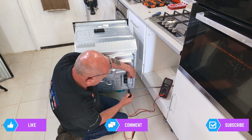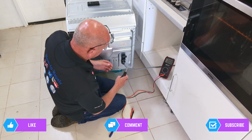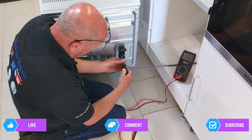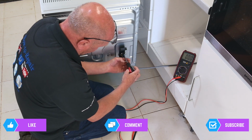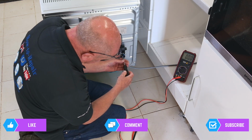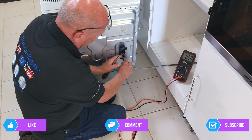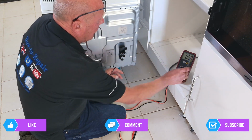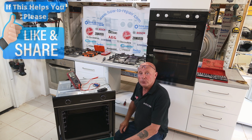Undoing the retaining clip, move that away. Now we can undo the live, the neutral, and the earth. The cable can now be pulled out and put safe. And there you go, the cooker's out of situ, ready to work on.